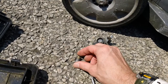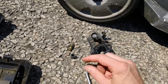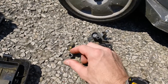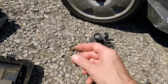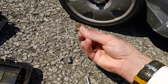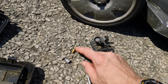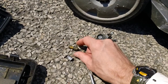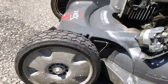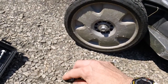Let's take it apart and show you what it looks like inside. There's a little sleeve on this piece — looks like steel or aluminum, it's relatively light. Then you have a copper-colored piece. What happens is this copper piece heats up, and a little rod inside comes out and pushes against the back of the plunger hole.